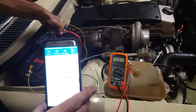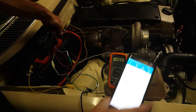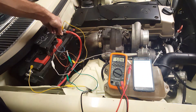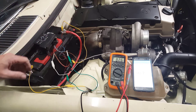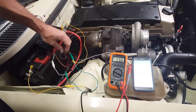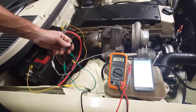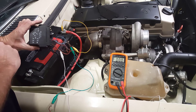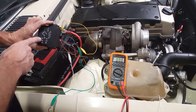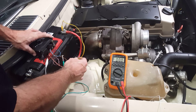You can see the meter at 12 and a half volts. The relay just clicked off — it was about 30 seconds. We dropped voltage down into millivolts, so it's really not even registering. So I'm going to wire my dash indicator in with one of the glow plugs instead, since the draw is not significant but it'll be more accurate. I'll piggyback six off of glow plug four, hook my lighting up to glow plug one, and then it's just my ground wire, key wire, and battery wire.